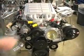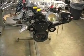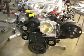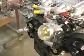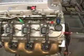As the fuel comes in, it tees here and feeds this rail and the other rail also. So a lot of neat things about it. Notice the water pump is totally different. Another thing you'll find in 2009 is the water pumps have changed and even the thermostats. The thermostats were the same from '97 to '03, and in '04 and later changed again.